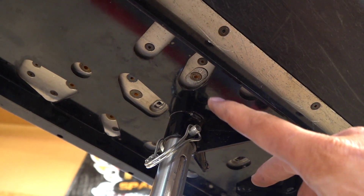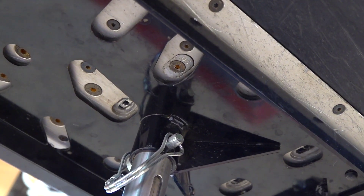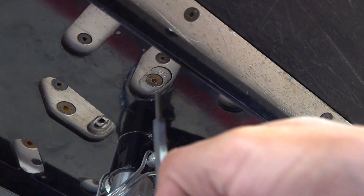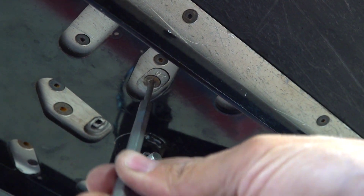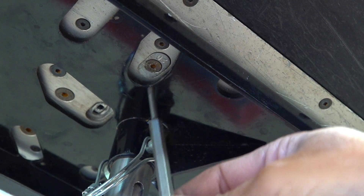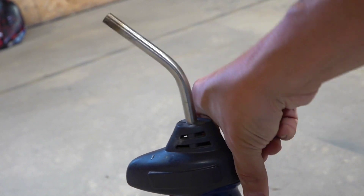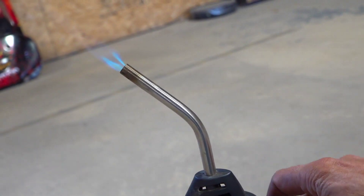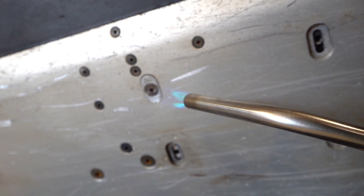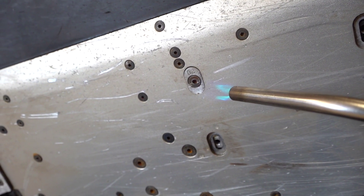So I've removed the other two inserts, and this one — this screw is actually seized and starting to round out a little bit there. So I'm gonna take the torch and heat this up, and then use a hammer and slightly tap this in to give it as much depth into that screw as possible. I also wanna make sure that there's no debris in there so that this bit can get as much bite to get that out. My goal is to help any thread lock that's in there just melt away so when I go to turn the screw head, it won't cause any resistance.